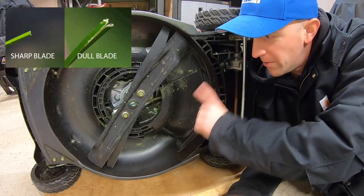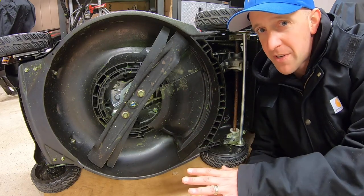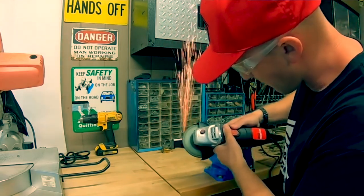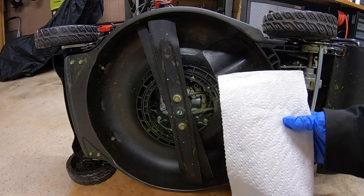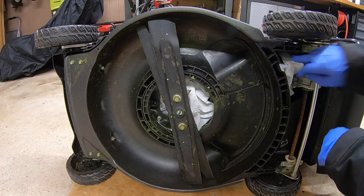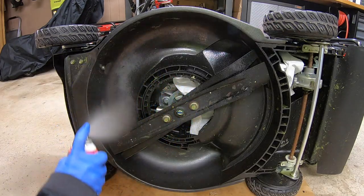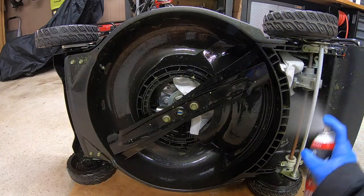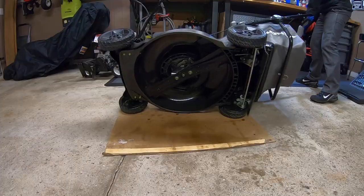This is also a perfect time to sharpen your lawnmower blades. I actually sharpen these blades right before my final mow of the season. I did a video this past season on how to sharpen lawnmower blades — I'll have that video linked down below in the description. After I sharpen the blades, I like to protect everything underneath the deck. A quick shot of silicone or WD-40 on the deck and the blade will prevent rust and, as a bonus, prevent grass from sticking in the spring. Be sure to cover your belt with a simple paper towel to prevent slipping, and put a piece of cardboard down when you're done to catch any drips.